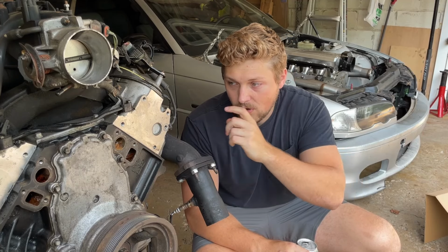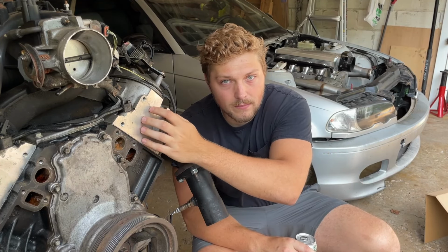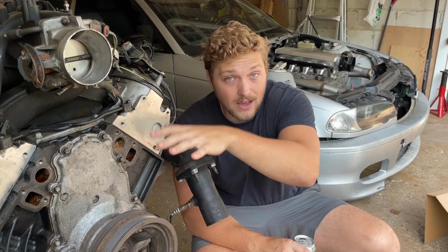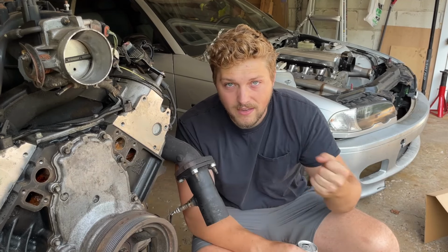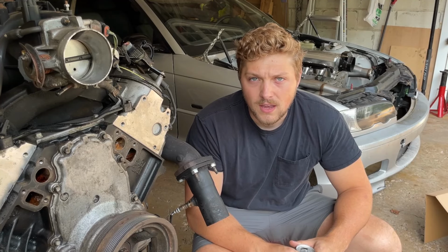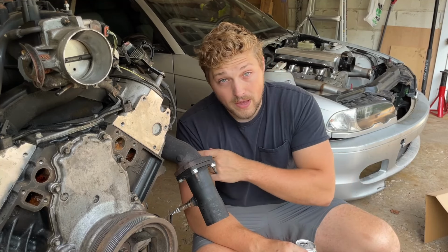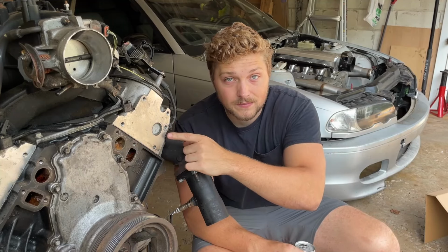What I want is at least power steering. I don't really need air conditioning right now, so I'm gonna run the Camaro F-body 98-02 power steering pump. I'm gonna relocate the alternator from where it is normally to elsewhere. I wanna run this crank pulley just because I already have it. So I looked around online and found a kit that'll allow you to adapt it, and I got it, and it's in now. So what I'm gonna do is do the oil pan, and then do the accessories, and if I have time, do the intake.